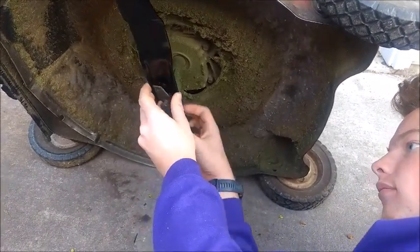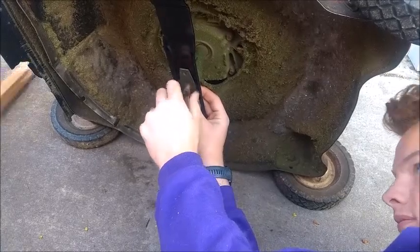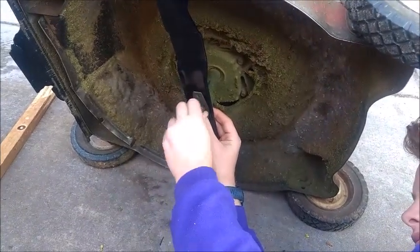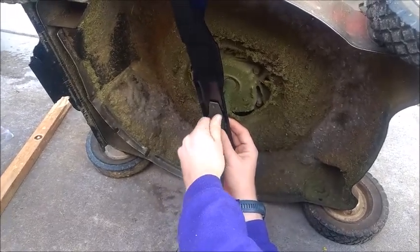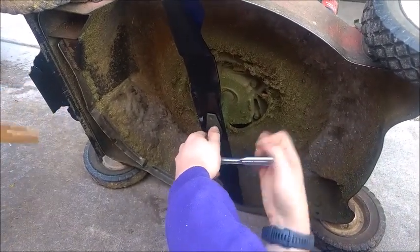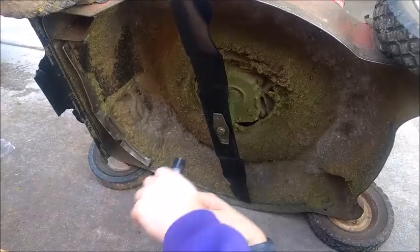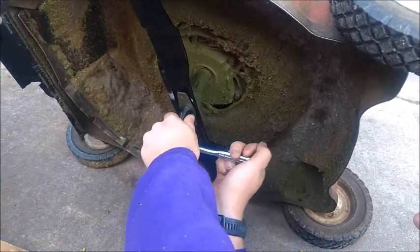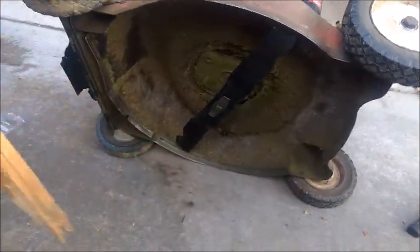Line the holes up and screw it in. We could add some oil or something, but the problem with adding oil is you don't want the bolt to work itself loose. That's a catch-22 — you want it to be on securely without cross-threading, but you definitely want it to stay on. Make sure it's lined up, get it snugged down pretty good, adjust the ratchet so we're tightening it this time. Wobble it with your fingers a little bit to make sure the holes are aligning.